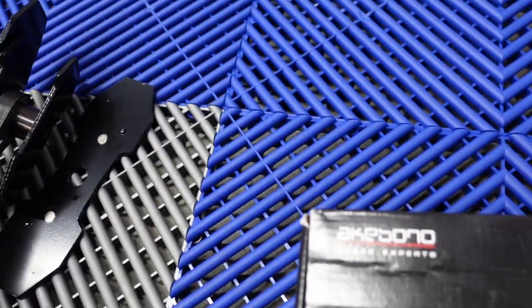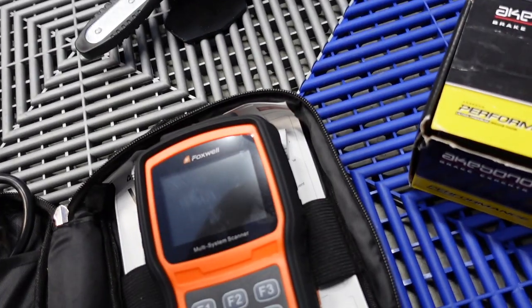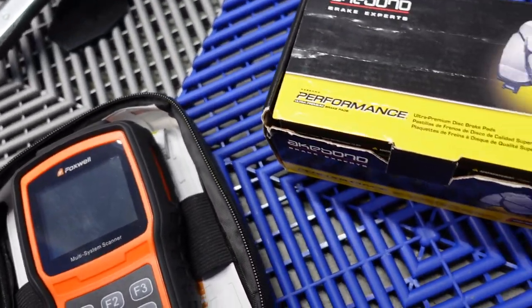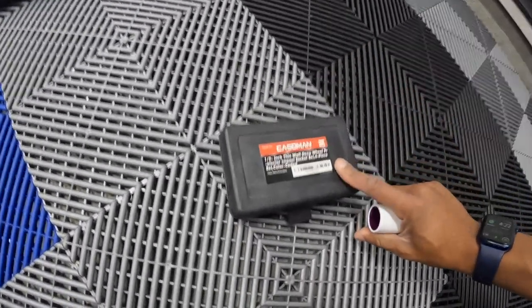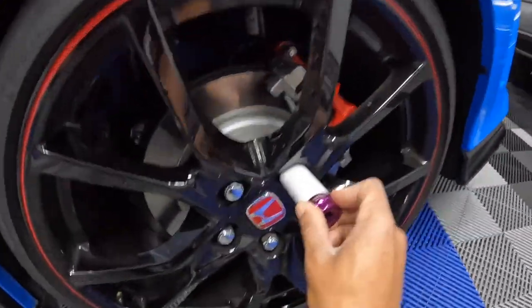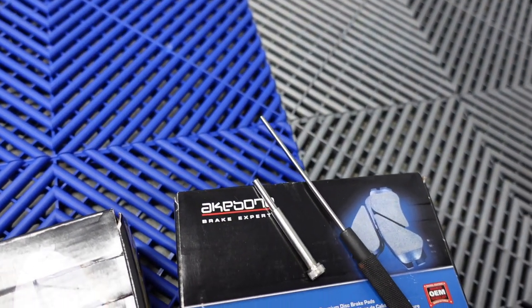You'll need some type of caliper spreader. You're also going to need a device to put the parking brake into service mode, because there'd be no way to retract the piston electronically back into the caliper otherwise — I'll link that in the description too. Optional but recommended: a torque wrench and an impact driver set. For the wheels, I'm using Casomen deep-well wheel protector sockets — they have a plastic coating so they won't chip anything. You'll also need two pin tools: one by Brembo and one generic. I sometimes work better with the generic one to push the pins back.